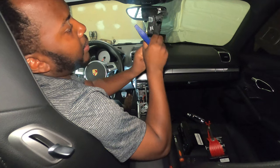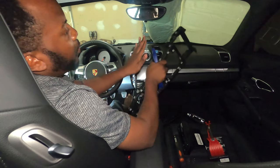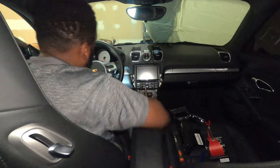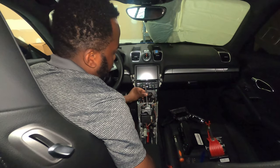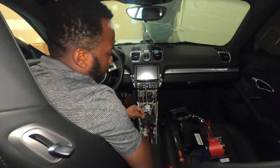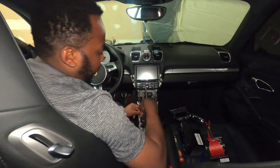To fully remove this trim piece, pull it up here. It's a little tricky — there's a clip right here. Take a tool, put it on the side, and push this clip so you can release it. Once you release that clip it comes out pretty simply. Put it to the safe side. Now you have your shifter exposed — you just have to remove four T25 bolts. Before you do that, take a picture of the way the shifter is set up so you can mount the new one exactly the same way.